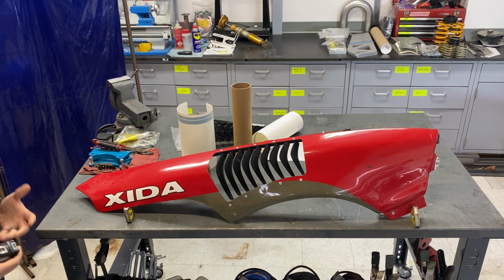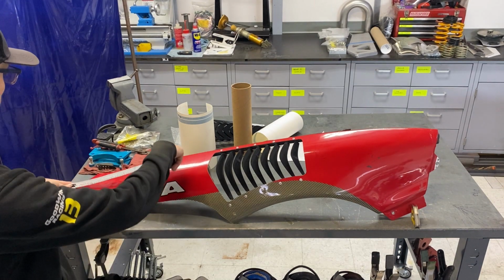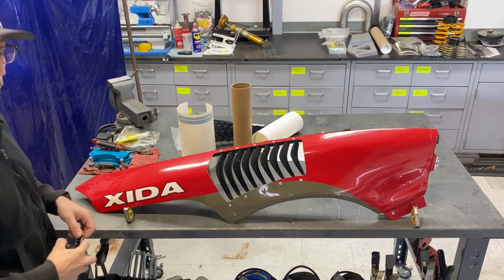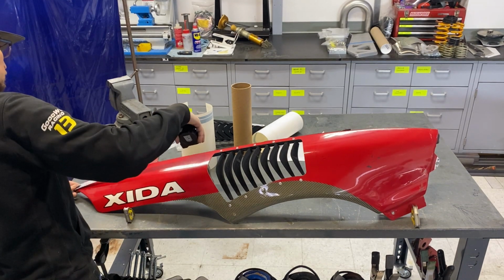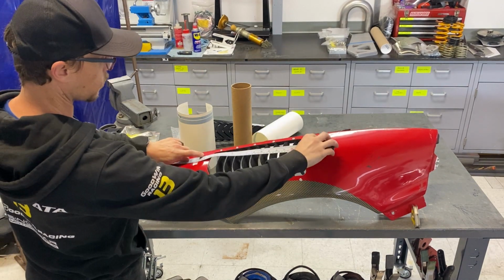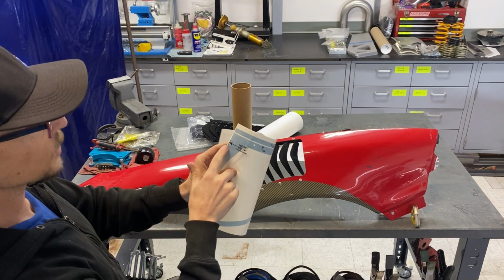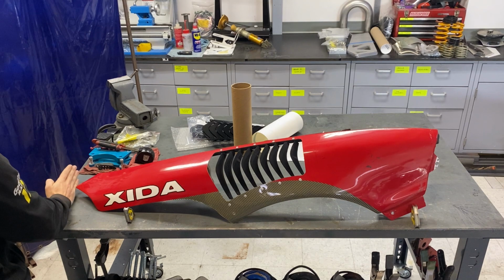And that just makes kind of an easy reference point, because you can take a measuring tape and put the lip right over that corner, and there's really no question of if you're on the right spot. The fender doesn't go any further than that. That's where you're measuring from. So on the NA fender, I will be measuring 20 inches, and so 20 inches is right here. So 20 inches is where that edge of the template that arrow is pointing to, that's where I want that to be. I want that edge to be 20 inches to the end, at the back edge of the fender.